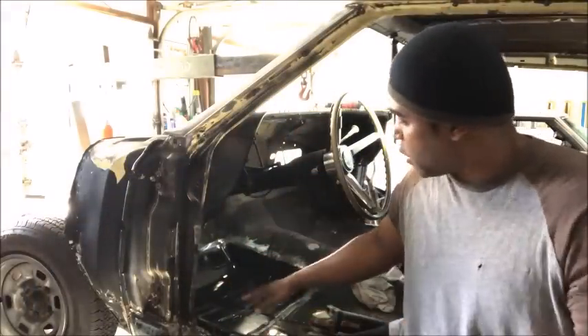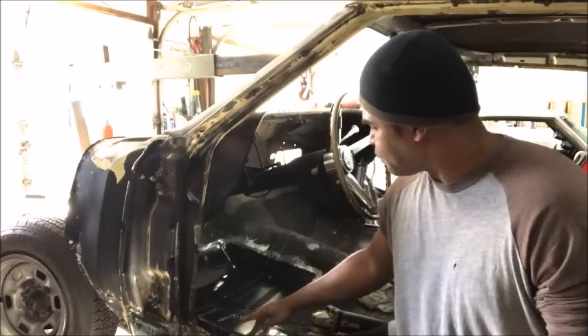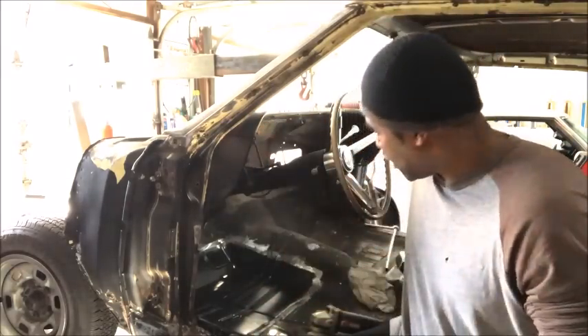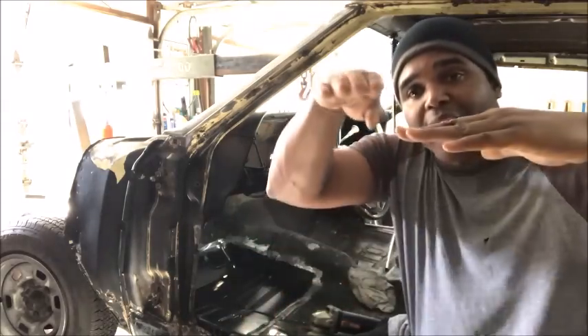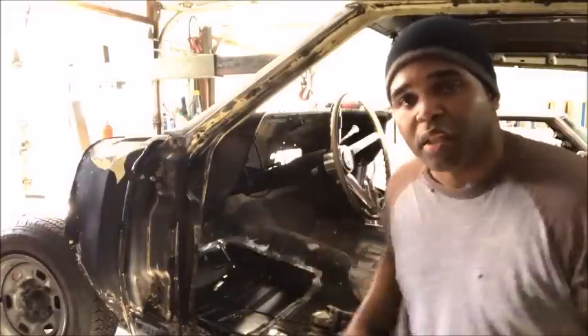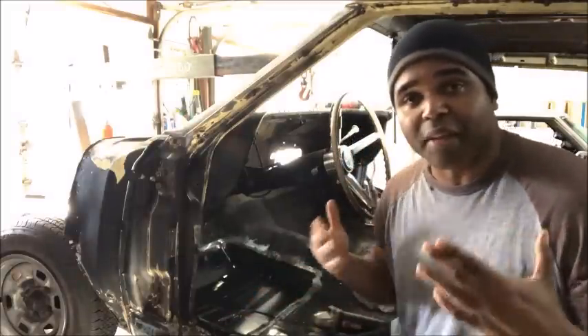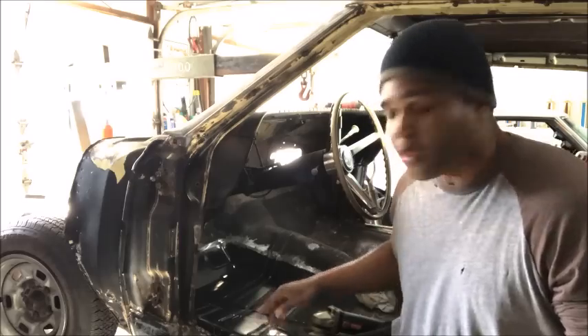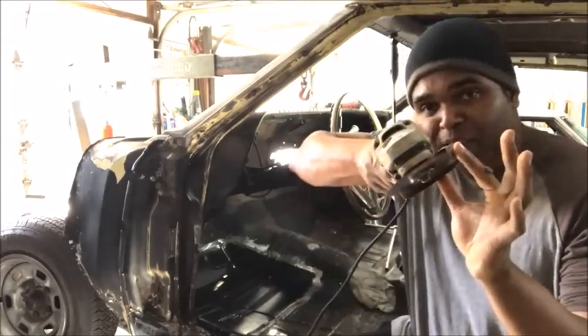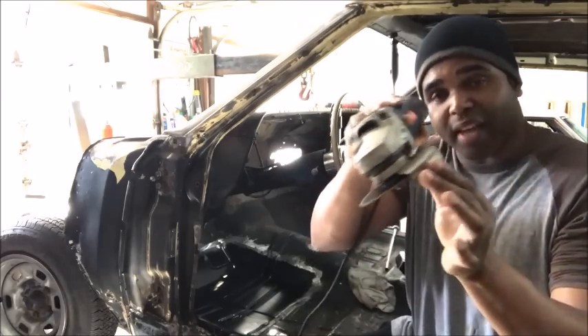At this point, what I've got is I trimmed up the new piece and got it in place where I want to burn it into place. I got it sheet-screwed in — I love these sheet screws. Right now I have about an eighth of an inch all the way around, and the new pan is just resting about an eighth of an inch over the old metal.